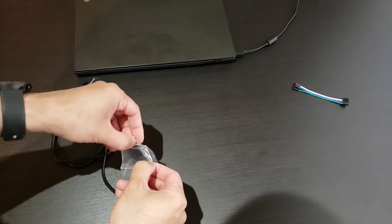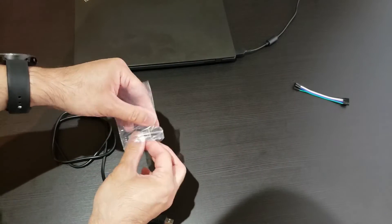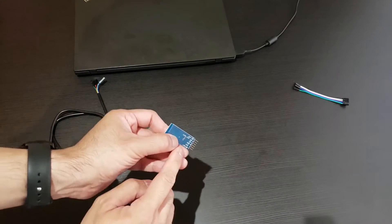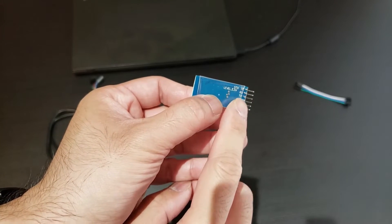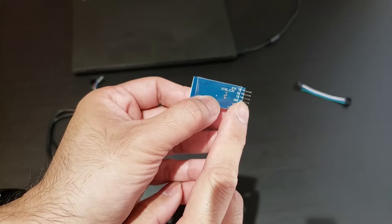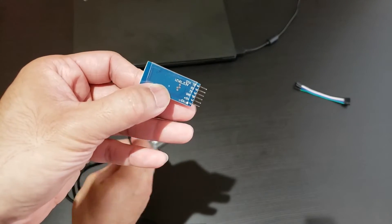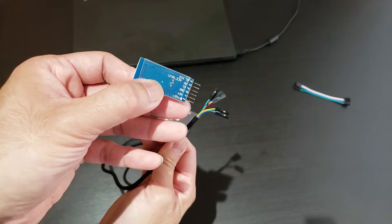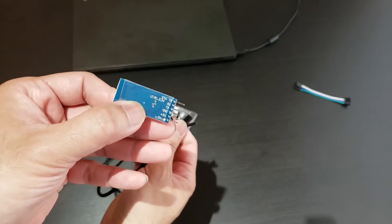Right out of the pack you're going to get one of these chips. It's wrapped in plastic so you don't have to worry about static shocking it or anything. On the back there's a wiring pinout that you're going to have to follow. The only difference is that with this cable you're going to have to reverse the TX and RX — that's the only way I got it to work to be able to program this.